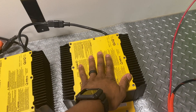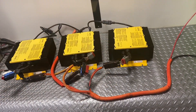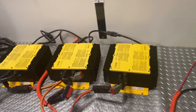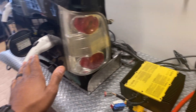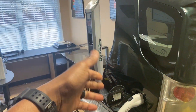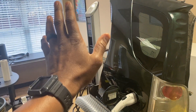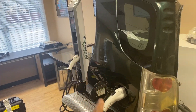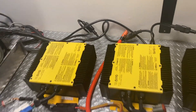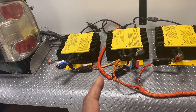The energy supplied into this will dictate which charger is engaged to charge the battery pack. This is standard low-level charging — it takes somewhere between 6 and 12 hours depending on how much is drained. If you put in Level 2 charging, which is typically between 7 and 22 kilowatts, that usually engages both chargers and will charge the vehicle anywhere between 3 and 4 hours.